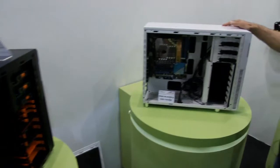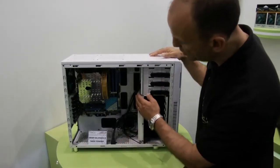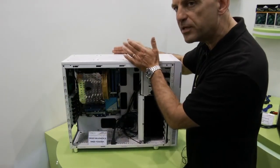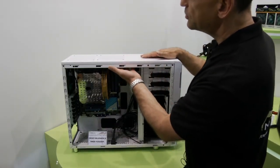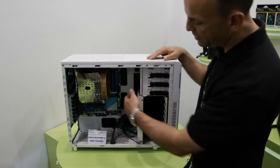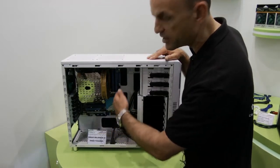This case, we call it DS1. This is also available already on the market. And the DS2 is different to the others we made before because here we made it pretty long. It's narrow, it's 207 millimeters only. That means you cannot get any water cooling solutions very nicely added to the top of the panel. That's why I made it longer, so you can have 2 fans beside the hard drive cages, add a radiator, or you can even set up push-pull solution with 2 additional fans here.